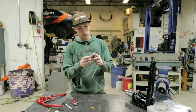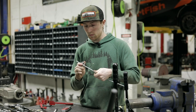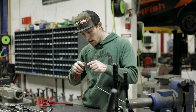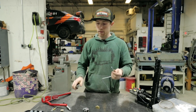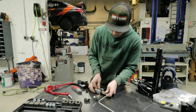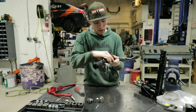We would cut our brake line to length — I'm going to cut it a little shorter just to show you an example. This cutter just has a little blade in there. It tightens on; this knob tightens the blade to the brake line and then you just spin it around, tighten it up a little bit, keep spinning, tighten it up, keep spinning. That cuts it. Then I take a little razor blade and clean the burrs off this edge so we have a nice smooth surface to work with. Now we're going to get our flaring tool out along with the correct dies and pieces. The brake line goes into the die and the tool tightens up around the brake line — you can see the brake line is kind of flush with this edge here.